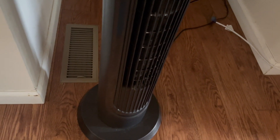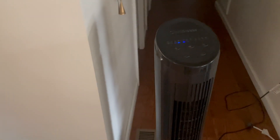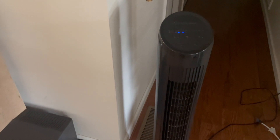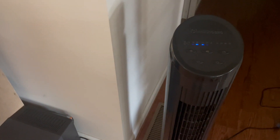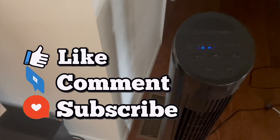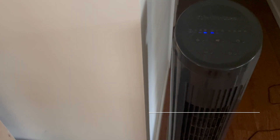That's a lot better! Rewind to the very first three seconds of this video and hear the difference. I see these fans on big trash day sitting out by people's trash cans or dumpsters — and really it's usually because of this issue. You can pick that fan up, open it up, grease the bearing, and you just got yourself a hundred to a hundred and fifty dollar fan for free. All it really cost you was about 15–20 minutes and a couple pennies worth of grease. If you like this content, please like, comment, and subscribe — thanks for watching, I'll see you on the next one.